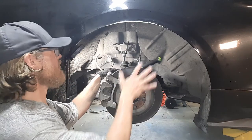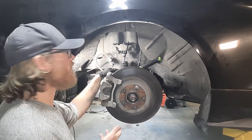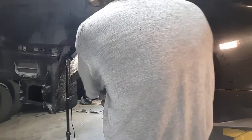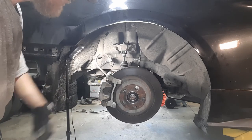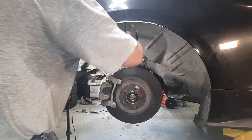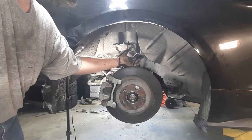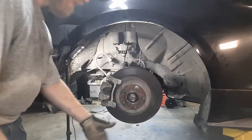When it comes to working on the rear suspension and brakes on the S550, pretty much everything is remarkably awful to access and work on — it makes me kind of miss working on the blue car a little bit. This is not a joy. Caliper's tight. Plop the wheel speed sensor back in — another little 8mm. And since we're not going to be using the e-brake cables anymore, the wheel speed sensor cable, right where the rubber buffer is, I'm just going to zip-tie that to the knuckle.